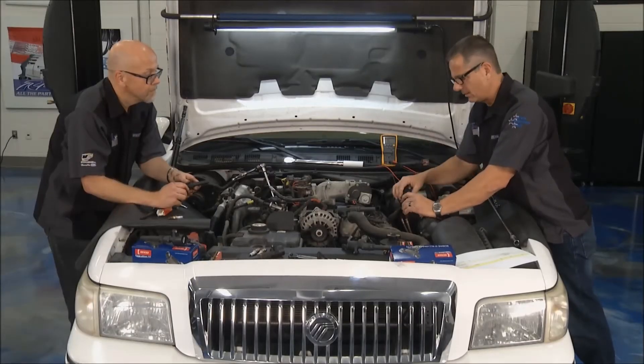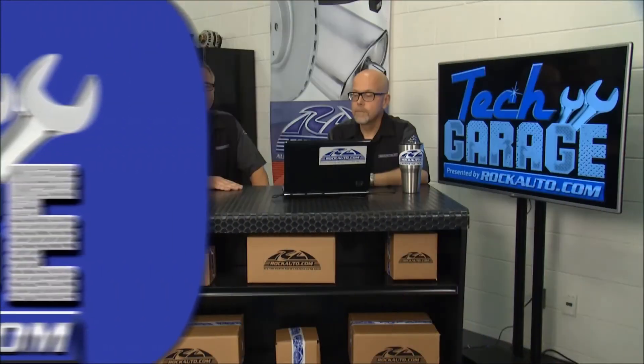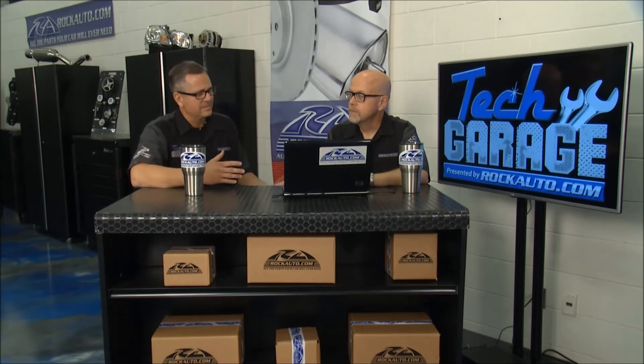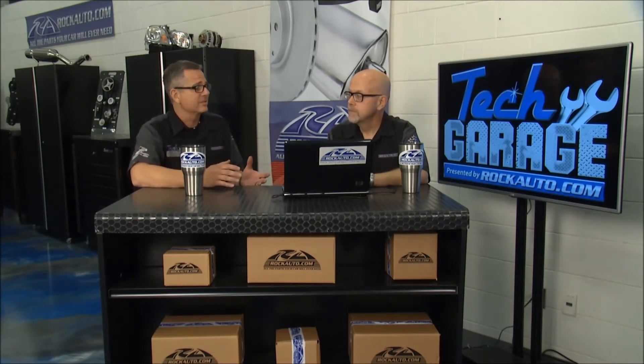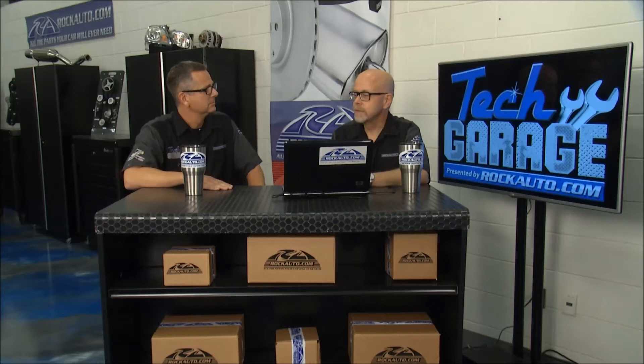What do you say we head over to the computer and look at the boots, the packages, and some of the coils we put on Project M&M? Our P0300 just turned out to be a misfire on cylinder number one, but we replaced all the coils — the chain's only as strong as its weakest link. There's the ignition coil, which always comes with a new boot, or you can just replace the boots sometimes. They're the equivalent of old spark plug wires — an insulator that could crack, a conductor inside that could break. So it's a good idea when you replace the spark plugs to replace those ignition coil boots at the same time.